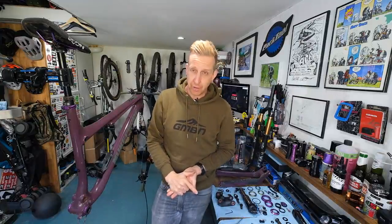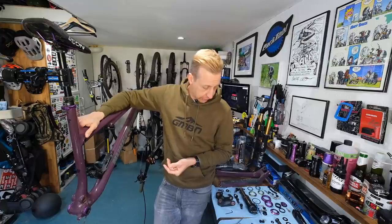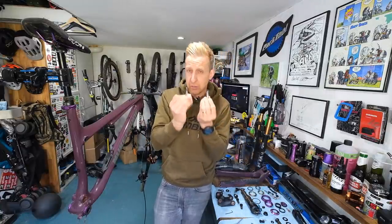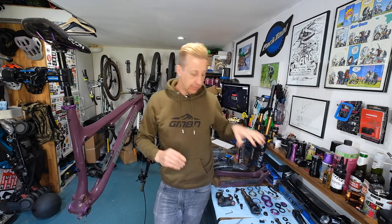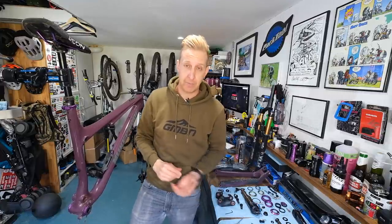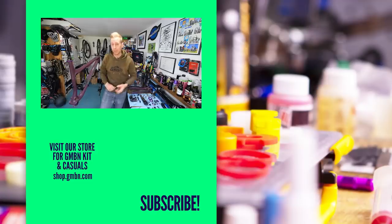Hopefully this video has helped you trace down nasty creaks on your bike and what to do about them. If there are any creaks from places I've missed, do let us know. If you've got any loose shock hardware you won't necessarily get creaking, but it's sensible to use thread lock on shock bolts as well. As with everything — if you're going to take it apart, lay it out in exploded order on a shop towel so when you put it back together you're not going to lose anything. Take your time, be systematic, and be sensible. Use grease where things have to move and come back out again. Use carbon assembly compound in relevant places. Use thread lock on bolts that can rattle loose — rattling bolts lead to creaking. Hopefully you enjoyed it; let us know what you think and if you've got any specific questions, please do let us know in the comments. See you in the next video.